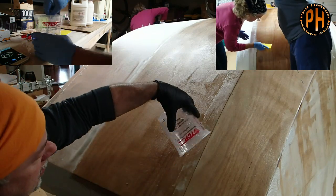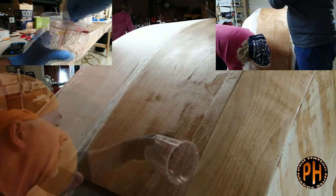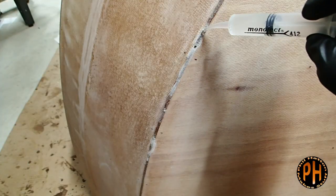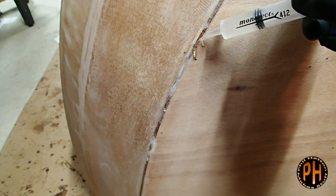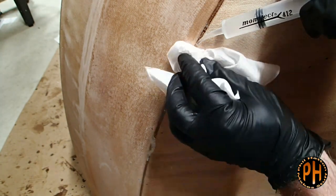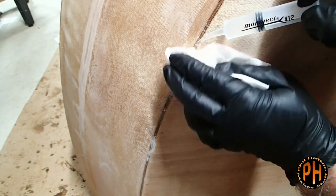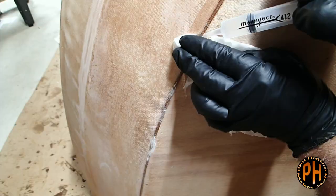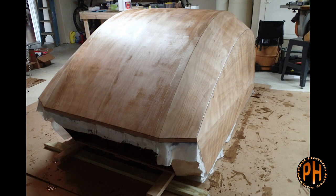Gaps can happen while using a spreader on the outside corners, either from an excess of fabric at the corner or from failing to fill in the gap with thickened epoxy earlier in the process. As you take your spreader around the corner where two sheets are overlapped, you tend to stretch the fabric in the direction you are moving, so one layer gets nice and smooth and the other gets pushed up and can bubble out. I had one such bubble at the front left corner of the camper, and made several attempts to fill it in before deciding to just sand away the fiberglass, fill it in properly, and overlay some fiberglass cloth. If you do this well, nobody but you will know. I'll show you this in a future video.